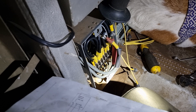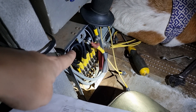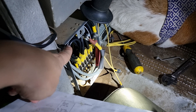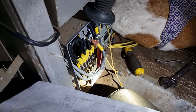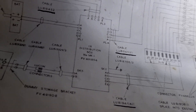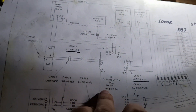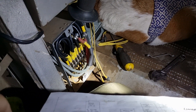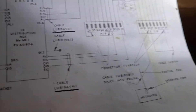I've been learning a lot about these infrared systems and interestingly enough there seems to be a few different types fitted, even within the Australian army - there's a fair few that were installed. They're all marked the same. Essentially they're all number one mark ones, like it says on this little one here. The problem is the wiring - I have actually found three different sets of wiring diagrams and most of them don't include this Metadyne wire.